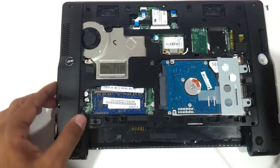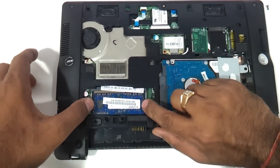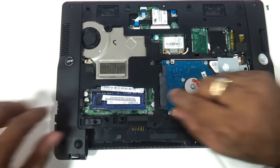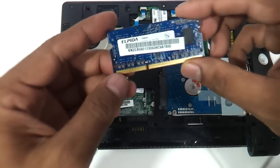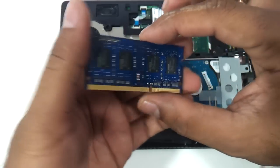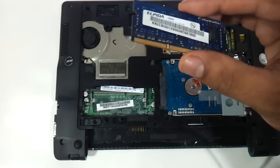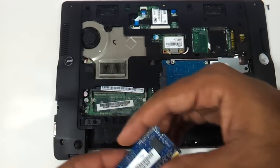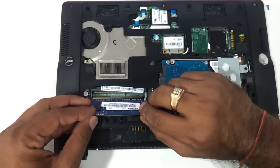So let me just show you what RAM it has and how it has to be upgraded. Use both your fingers here, just press in the opposing direction. It will come out — the notches will release it. This is basically a DDR3 SO-DIMM memory. So just take something similar. It's an 8-chip memory. You can take a 16-chip, that would be better, but an 8-chip will also work fine.